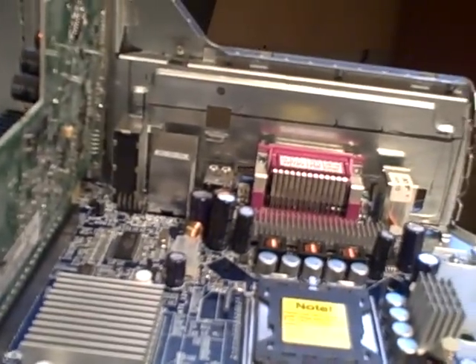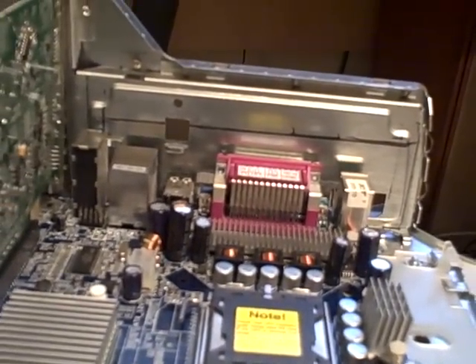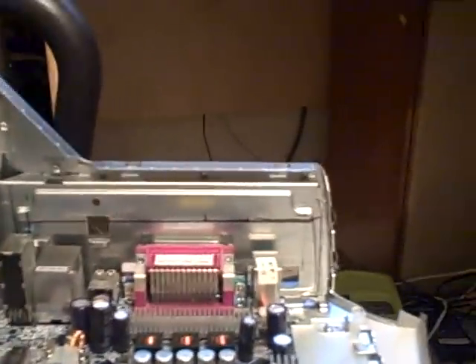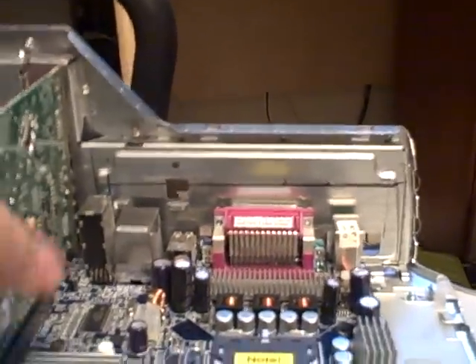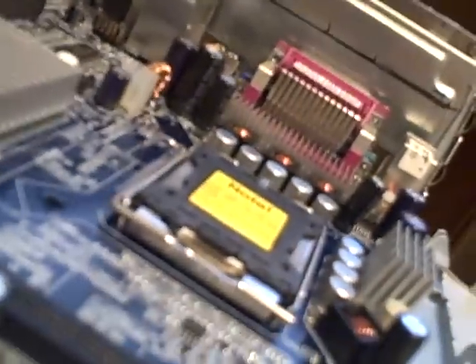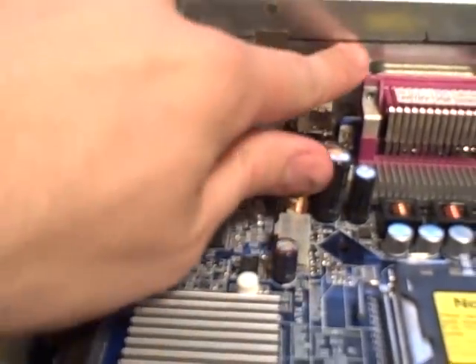So that poses a problem. But I got to looking, got a picture of the motherboard I'm going to use, and it turns out it's got one of the small PCI Express slots right here in the first slot. And then the second slot is the full-size PCI Express slot — the video card. I have no plans of using the small slot. So we can line everything up to where the second card slot lines up with the first hole. When I do that, it puts it a lot better. I've already marked it — this is where I need to cut, all along this line, up along here, and then it's going to come out right here at the edge.